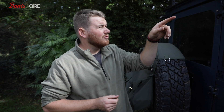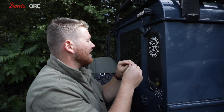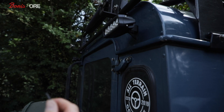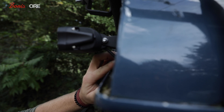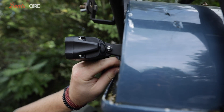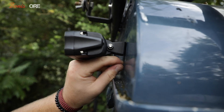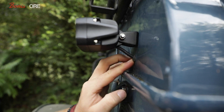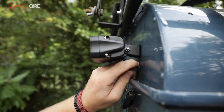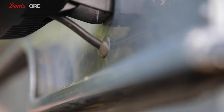So on the old hole, which I couldn't size up myself, it's a bit loose around the wire and I can imagine water sort of coming down the wire and then into the cab. So I've got Dum Dum, which is sort of a black blu-tack type thing, and you just put it around the cable to cover up the hole. It's sort of a putty that never sets but does go a little bit hard, and that'll just seal it up there. Not the neatest but not everything on Boris is the neatest, so it's looking pretty good — that'll just stop the rain from coming in. I'll do the same on the other one but not nearly as much. That'll just keep the weather out a little bit.